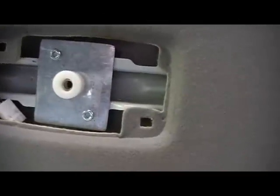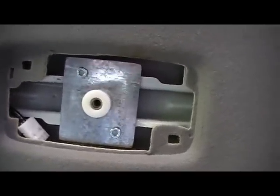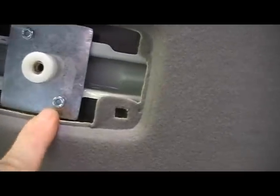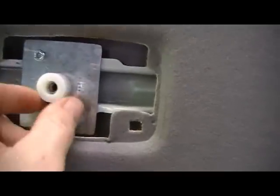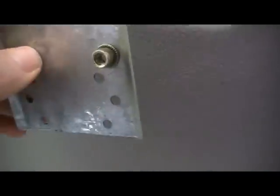Now I've put this plate in. We've used the wrong size drill bit. My son gave me a 4.5mm instead of a 3.5mm. I didn't check it, but anyway, what I've used is some Allen key bolts with nylock nuts on the other end, and that'll obviously secure a lot better when going over corrugated roads. Now it's just a matter of mounting this plate.